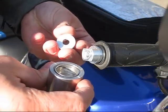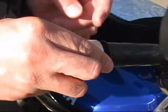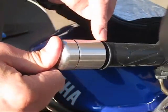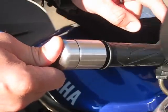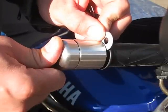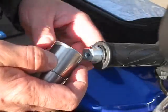Here's the part where you adjust the clearance between the throttle and the grip. You put in a certain number of shims — the manual will tell you — just to start out. You put them right in there, then you lay your throttle lock against the grip like that. What you're looking at here is very excessive clearance, so we need to go down. Take some shims out. This is still too much. On this bike, it's actually going to be necessary to put compressed air behind this grip or do something to hike the grip out toward the throttle lock because it can't make up that distance. The ideal amount is about a 32nd of an inch to a 16th of an inch. Once you've established that clearance, however many shims you put in — that's how many you assemble it with.